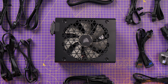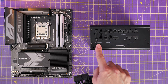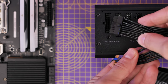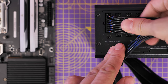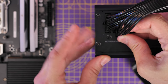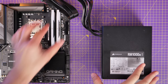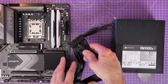Next we're moving on to the power supply unit — the RM Shift from Corsair. I've done a separate guide for this but I'll show the basic connections. The 24-pin power connection is split into two parts on this PSU — markings on the PSU end, and the large part plugs into the right-hand side of the motherboard. This is the most important cable — if it's not secured properly, your PC won't power on, so make sure it's seated until it clicks. The wiring logic is the same with every PSU, so don't worry if you're using a different one.